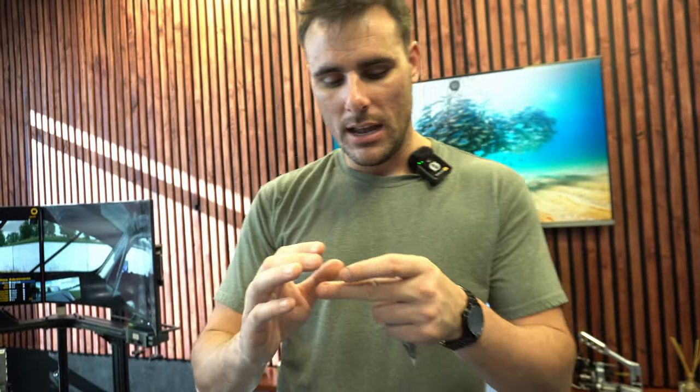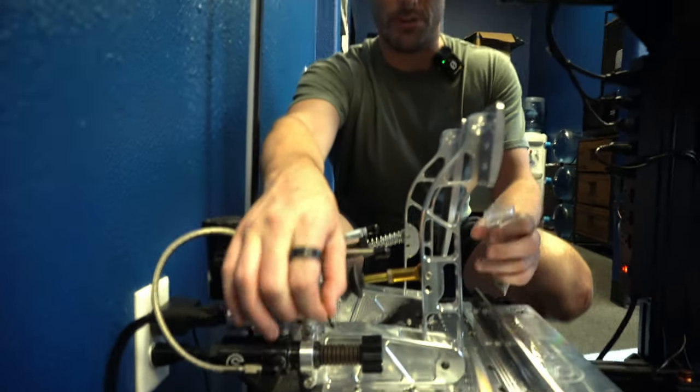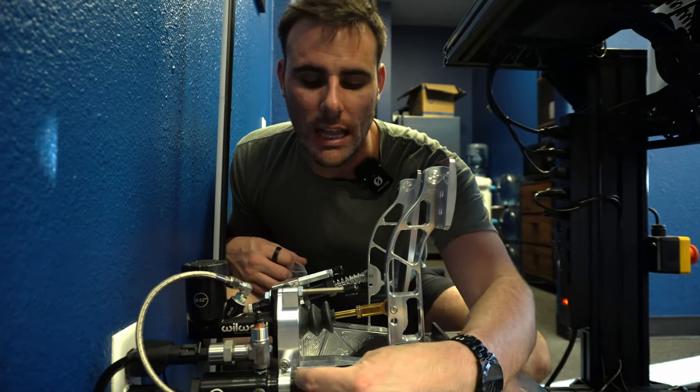The different thickness bevel washers allow us to create packs. Whether it's a really thin pack like this, it'll take very little pressure to compress. What we do is get these packs and put them on our hydraulic cylinders, right on the side of our hydraulic pedals — you can see there's a bunch of them packed together right there on the shaft. And as you apply the brake pressure, it collapses these packs.